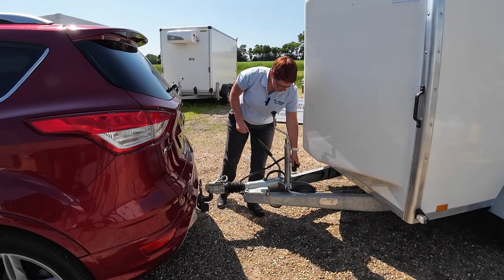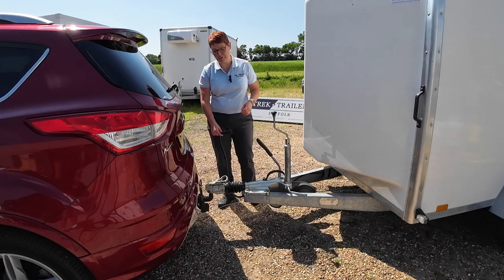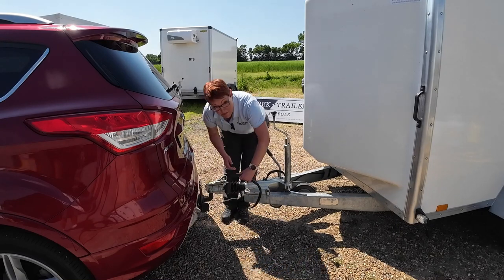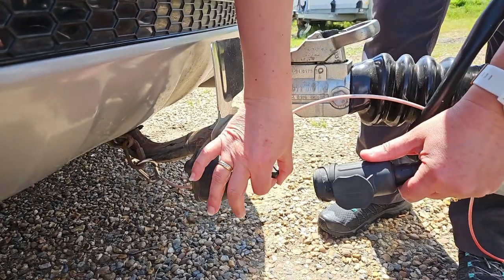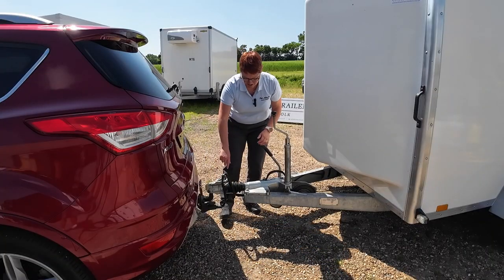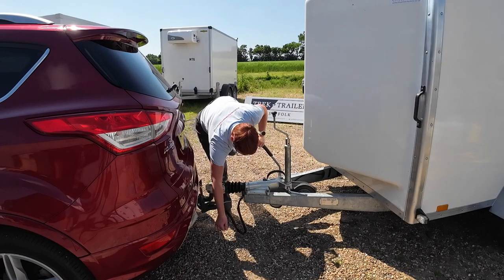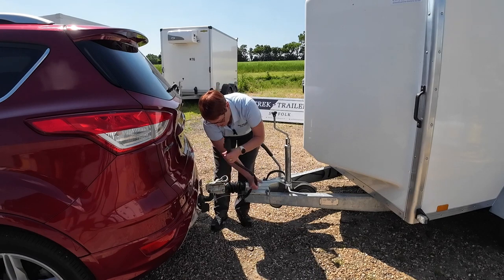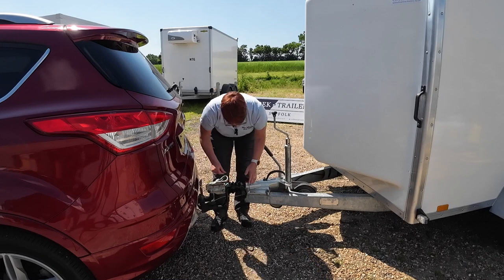Electrics now. This is a 7-pin plug but quite cleverly it's in a 13-pin casing, so it's going to fit into my car without any adapters, which is a right result. Now don't worry that the cable is sitting up — we actually want it to do that. We don't want it dropping down. If it is really long you might need to put a little kink into the cable so that it doesn't drop.